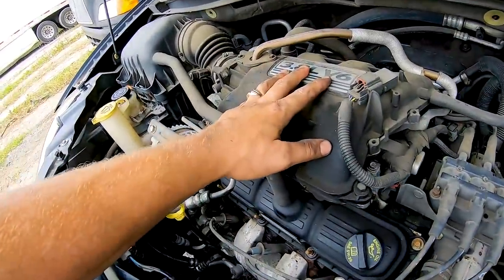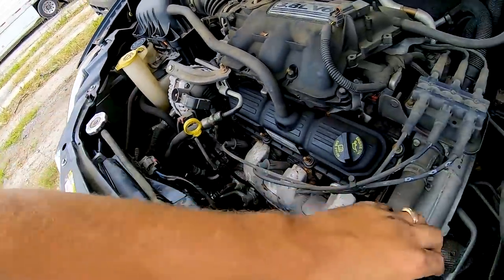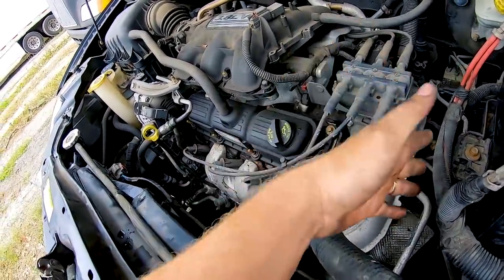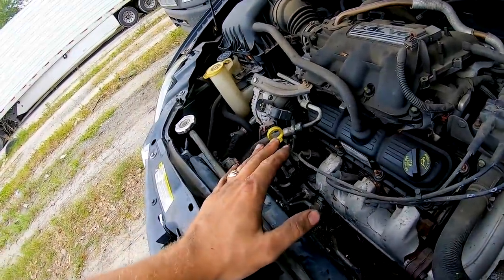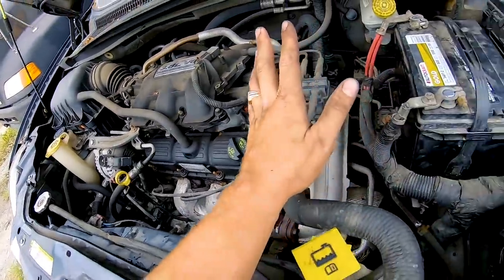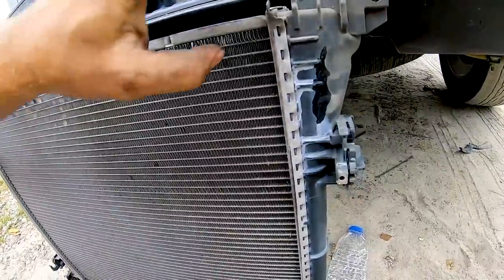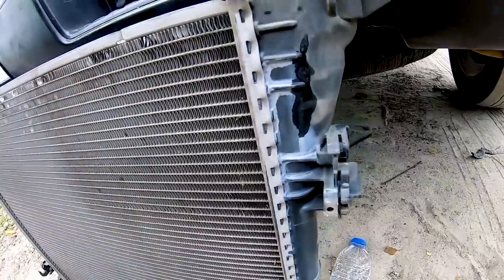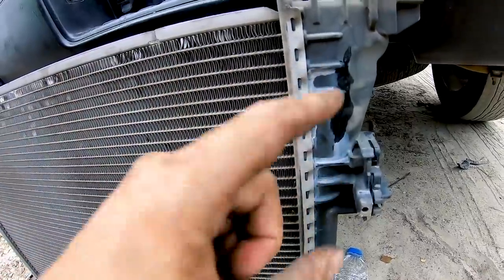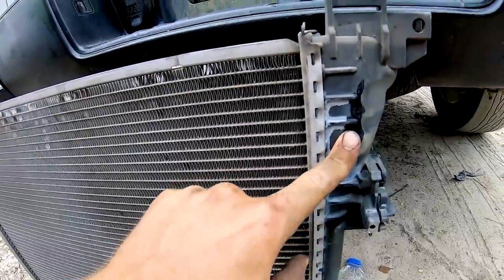She sounds good, but she's vibrating pretty hard. We're going to let her warm up, turn it off, check the coolant again, and put more coolant in there because it's still going to bleed the system. The thermostat is going to open and water will start circulating, sucking some coolant up. Now here's the original radiator — there's a crack right there by the plastic and aluminum junction, and all this white stuff is coolant that's been leaking over time. Somebody's been just adding coolant. Hopefully it didn't blow the head gasket.